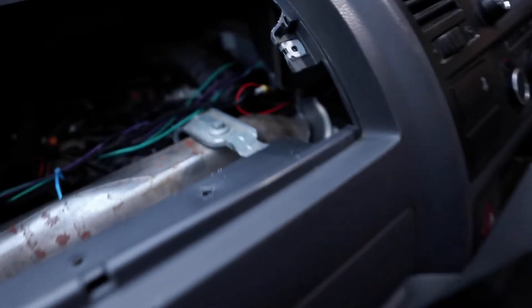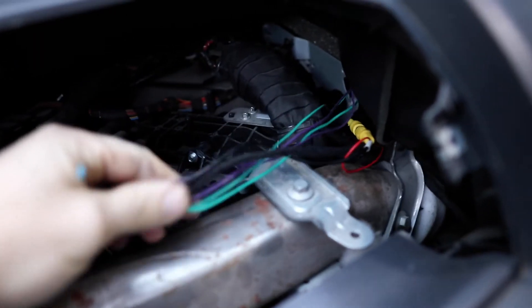In the glove box I've kept it purposely easy to remove. You can just see the blue cable coming out — that's where the little rubber grommet is. That blue cable is the 240-volt arctic cable, which is just a bit better, particularly for adjusting temperatures. You can also see various other looms in here — these are the speaker cables and reversing camera cables, all wired into the back of the head unit.